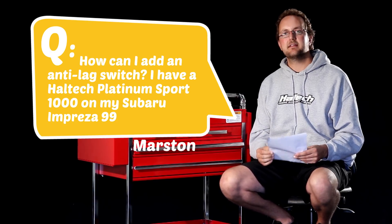There are two different types of anti-lag. One of them is a launch style, the other one is a rally anti-lag. A launch style anti-lag is typically used off a clutch switch that goes into an input on the ECU. When that clutch switch is pressed it introduces a rev limiter, retards the ignition timing and adds fuel enrichment. So as you hold full throttle and you're on the clutch stationary, the engine will build boost and you sidestep the clutch and take off with full boost.